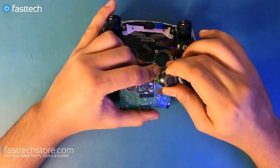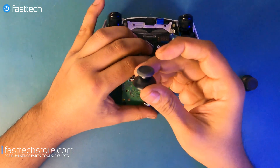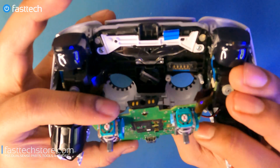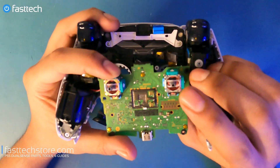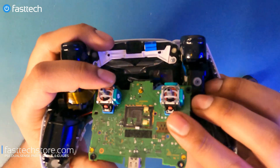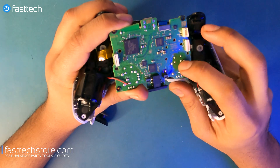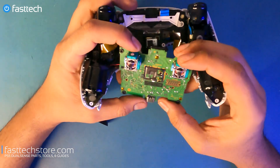I'm going to remove the analog sticks. These look very similar to the PS4 analog sticks, and the analog stick itself looks like it's the same from the PS4 DualShock 4 controllers — which is disappointing because these are known to fail and cause analog drift. It's disappointing to see the same design in here. To replace them you have to desolder them using a hot air station.